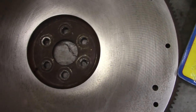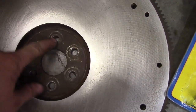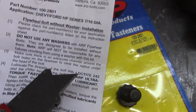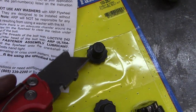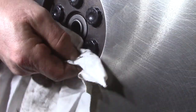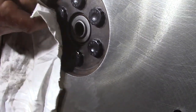We got an ARP bolt kit to put this flywheel back on. The instructions said to make sure there's a chamfer here — well, there was none, so we just put this on the drill press with a real mild chamfer on it. We got this mid-plate back on it, wire wheeled it to try to keep everything as accurate as possible. We're going to use some Loctite under the threads and then the ultra lubricant under the heads of the bolts, just cleaning this up so it doesn't wing off and get into the clutch and pressure plates later on. All these are torqued down now.